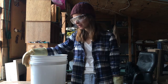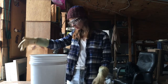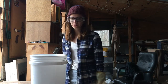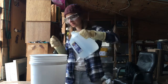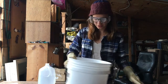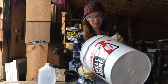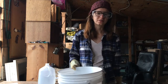To mix your electrolyte, you'll need one immaculately clean bucket. To make sure it's clean, rinse it out with distilled water. Do not rinse it out with anything else — do not use soap, do not use tap water, do not use bottled water. It really has to be distilled water. Pour some in, swish it around, and look for impurities. You really want to avoid contamination through this entire process, because contaminants in the electrolyte can harm your battery and shorten its lifespan.